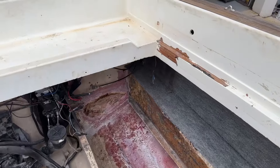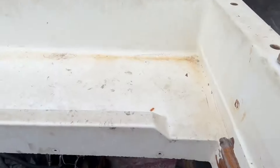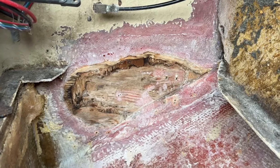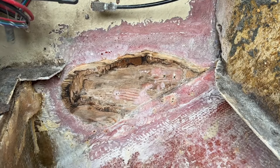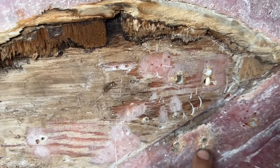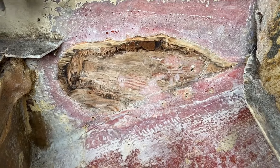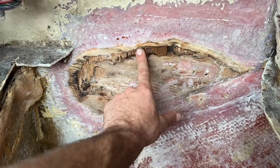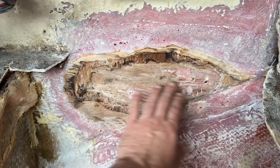Before I wrap this up and we do a lot more fiberglassing, I'm going to show you guys back here on the port side transom. The previous owners — whoever mounted the swim platform and the trim tabs — did an awful job. You can see one, two, three, and four — these four holes were holding the swim platform. They had the swim platform support beam or support rod mated against the trim tab, and what that basically did was just caused it to leak. As you guys can see, the wood is a little wet right in here, a little wet right in here, and obviously it was wet in this midsection before we knocked it down.